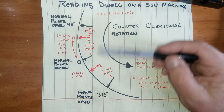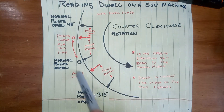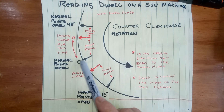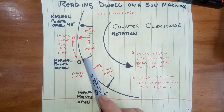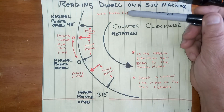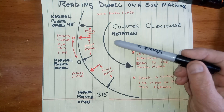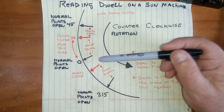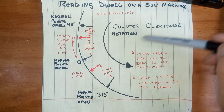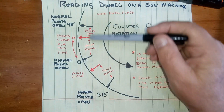When initially set up in normal, you'll have the flashes. There's a movable ring, and what you do is place that movable ring so the zero is at one of the flashes, and then you flip on the dwell flash, and you'll get twice as many arrows. You just have to remember that when you are reading dwell and it's going counterclockwise, you read the dwell in the opposite direction.